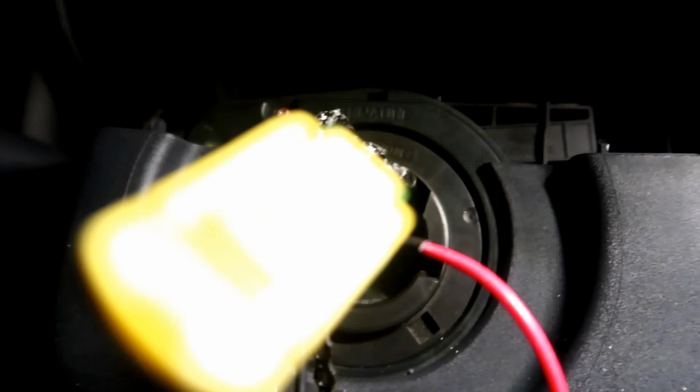Right. So, what I did there's a master spline on the car, and there's a little mark. This one's also got one. You might just be able to see in there, just at the top where that hole is, a little mark. You just line those two up and then get those two pins in, and that's it lined up.